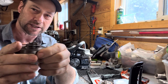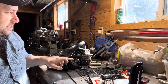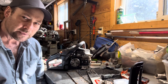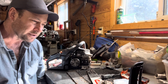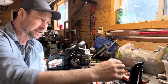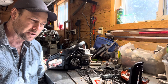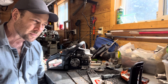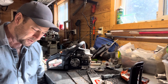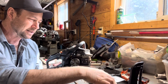The other thing you need to do is remove enough of this for it to actually engage in the worm gear of the oil pump. Once I get mine I'll do another video on that, but I thought it was important for people to realize there's a little bit of work involved to adopt these over, so that you don't end up ordering something and then want to scream at somebody because it's not quite what you're expecting.